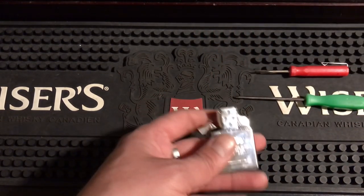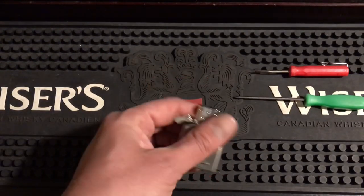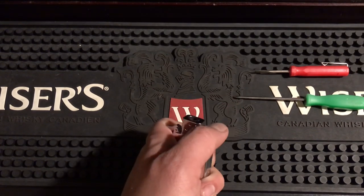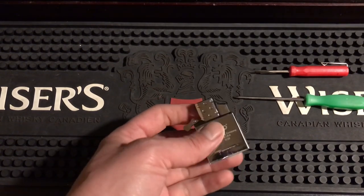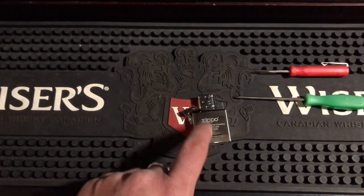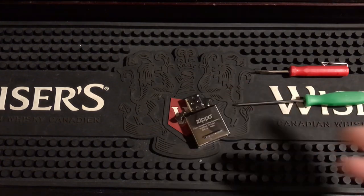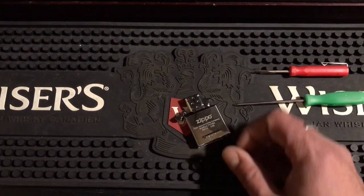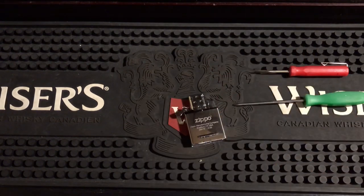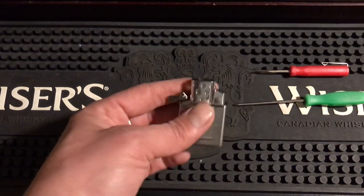If I hold it on any less, my Zippo only lasts like a day or two. And if you're noticing that your butane insert's only lighting up for like 4 or 5 lights and then it won't work again, it seems like you're not using enough butane. A lot of the times that's air pressure trapped in the tank too. You just bleed it out, hold down the button, try refilling it. And when you're done refilling it, bleed it out a little bit, let some of the pressure out, should be fine. But I highly recommend this fix. This is probably the best thing you're going to do.